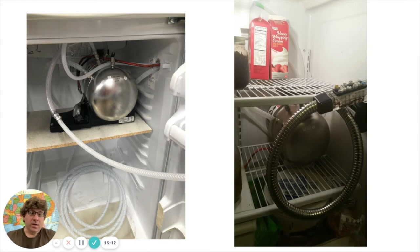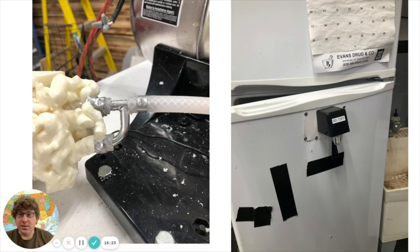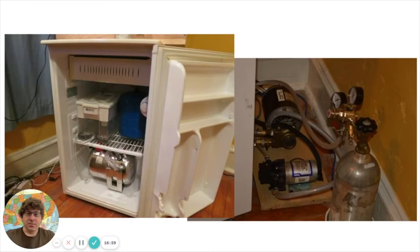On the right, you can see that some people used a bar gun instead of cutting a hole in the front of their refrigerator — that's another option. This is the Flowmatic 202 serving valve. On the back side, you have the pipe coming in, a Y-fitting going to the Flowmatic, because the Flowmatic actually has two inputs for water so you can get more volume when you're dispensing. So it's worth putting a Y on there and making sure it's stainless steel.